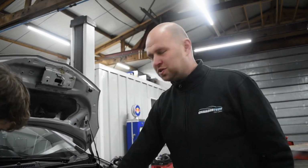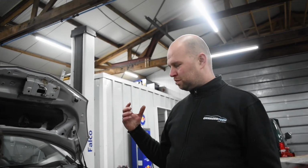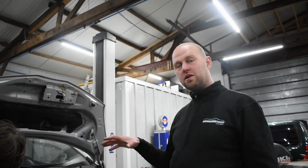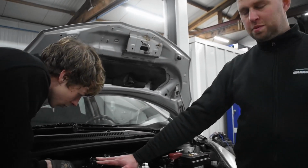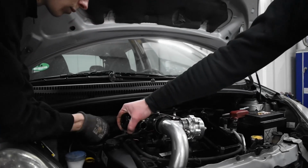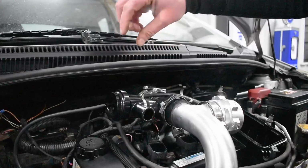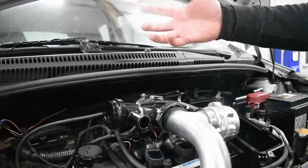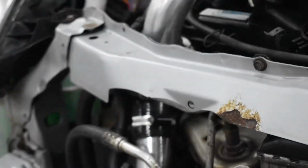But we know some of you would like to go further, so to be able to lower compression and perhaps install different pistons, then you are already prepared to do so. The blow-off valve can easily be tuned. Just remove the cap. It will also include some extra springs. You can change the spring, even remove a bit from a spring, and that way you can regulate the boost for your system.